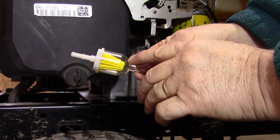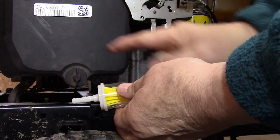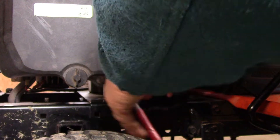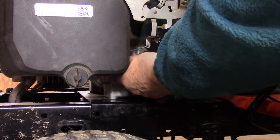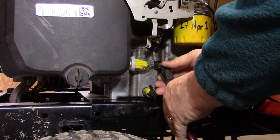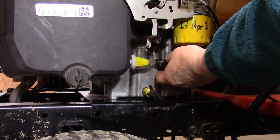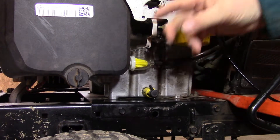There's our new filter — there's an arrow embossed in the plastic. It says the flow should go right to left, so we'll put this in here first. There's that side done, then we'll put the other side on and the clip on. Then we can take our hemostats off and the fuel is starting to flow through. It looks like there's no fuel in the filter right now, but fuel will fill it as the engine starts and runs.